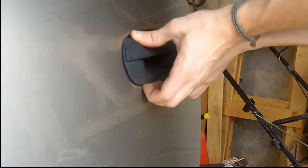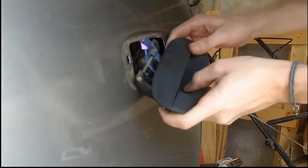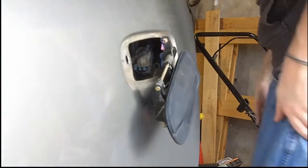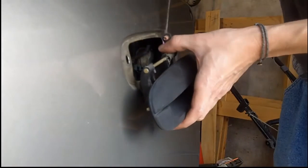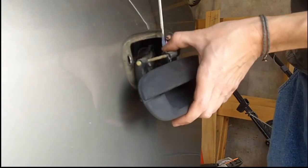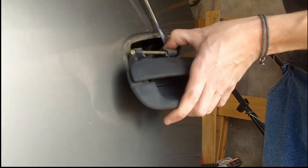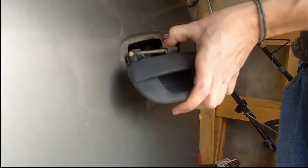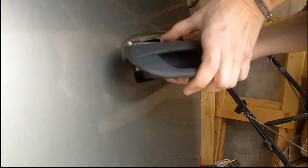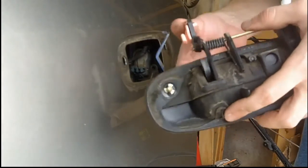With the door handle, you'll want to lift up and pull out — watch me rotate it just like that. On the back side of your door handle is the lever that activates the inside door latch. You're going to want to take that clip off — the little pink thing at the top is the clip. The old one doesn't really matter much, but this has been on the vehicle for 20 years, so I'm using a wedge to get behind it and pry it out because there's a little grime. It just pulls right out though.